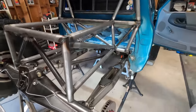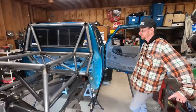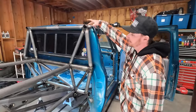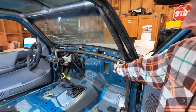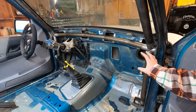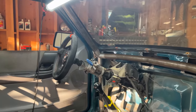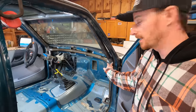Once that was positioned, I actually didn't start on the back section first. I started with the interior cab cage, because realistically to start on the back wall, I needed these tubes coming out of the cab. Getting this dash tube in was the very first thing. Instead of doing it other ways, with the space and wanting everything tucked as tight as possible, I went with the dash bar first as one tube that runs across the truck and then lands in the cab — silicon bronzed straight to the cab.